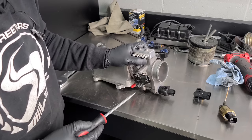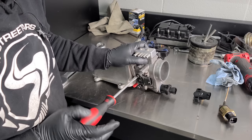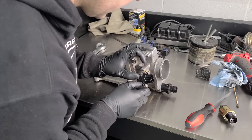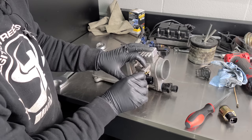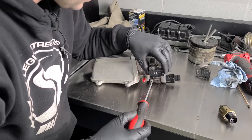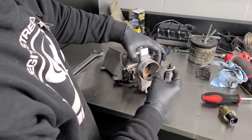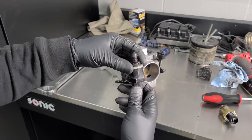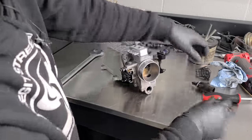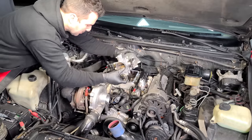Let's replace some sensors that commonly fail on these old 80s GM cars. These aren't bad, but we're here and we want our Grand National to be reliable — these are inexpensive, so let's just do it. This is the throttle position sensor — just a couple of screws. With the ScanMaster we'll be able to see the TPS voltage through the gauge, so we don't have to back probe anything. It's adjustable by measuring the voltage. Next up is the idle air control motor — when we first bought this car we kind of messed up by having it out of the intake with the key on. We're just putting a new one in with a new gasket. Tighten it up and the little intake plenum — with a new gasket and cleaned up — is ready to go back on. Welcome home, little buddy.